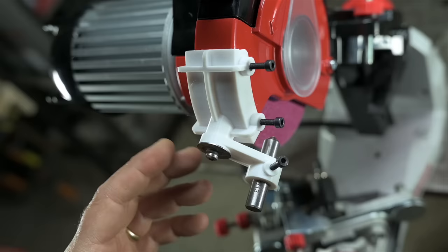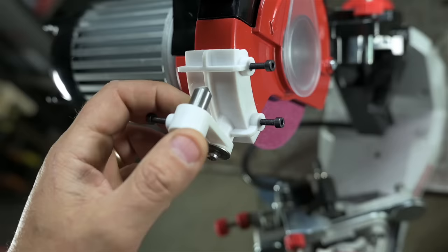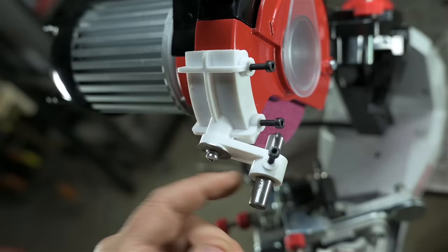But mount the nib at 10 or 15 degrees off. It still would swing that same plane that you needed to swing. But the way I did it, I may have just cut a flat on the tip of that diamond and completely ruined it. That wasn't a lot of dressing, but still, always mount these at an angle. Live, learn, forget, learn again.